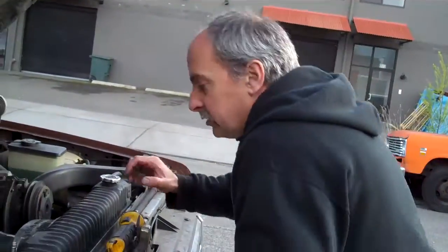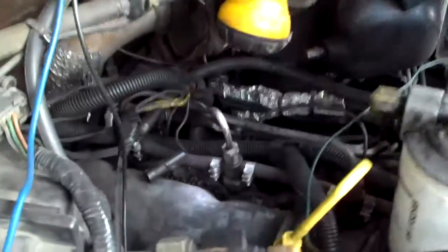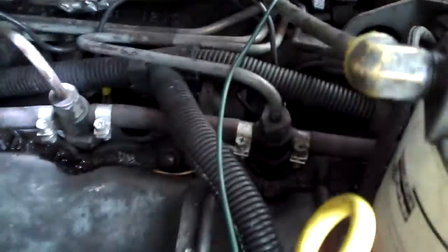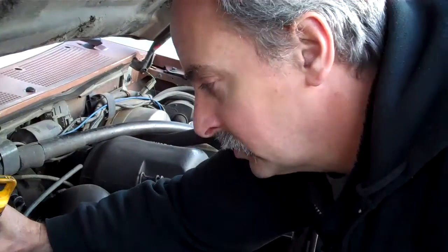These have a complex and interesting hose system on the injectors. The injectors have a plastic cap on top of them, just like this, with some o-rings. The fuel return line goes to those hoses and seals, which will eventually break down. But the truck's 20 years old, and it's quite the job to replace those — it's almost all the job of pulling the injectors. So that's a very good time to get your injectors rebuilt. It almost isn't a vehicle out there that doesn't need that done; they just run better.